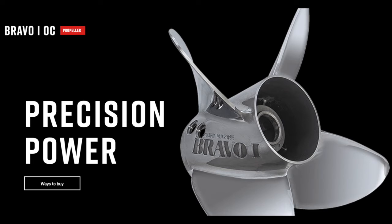Then we also make an OC Bravo that's got the barrel chopped almost all the way down to the blades. And that's really designed for twin outboard cats that generate lift on their own and don't need any lift from the prop. I don't think we finished the question.